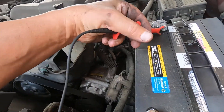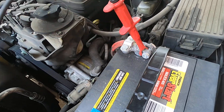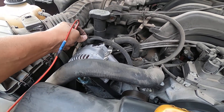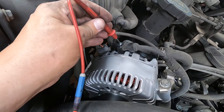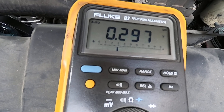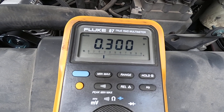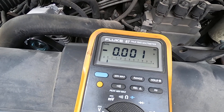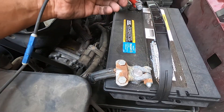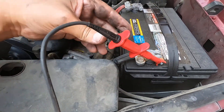Now let's do some voltage drops. I'm going to clip off here. It's always best to go straight to the center post of the battery. This just verifies the integrity of the wiring. I'm going to go right here to the center post of the alternator. And we have right at almost 0.3. 0.3 to 0.5 is an acceptable voltage drop on the B positive wire. It is best to turn on the compressor, and we'll do that just to see what the difference is — it'll be a little higher.